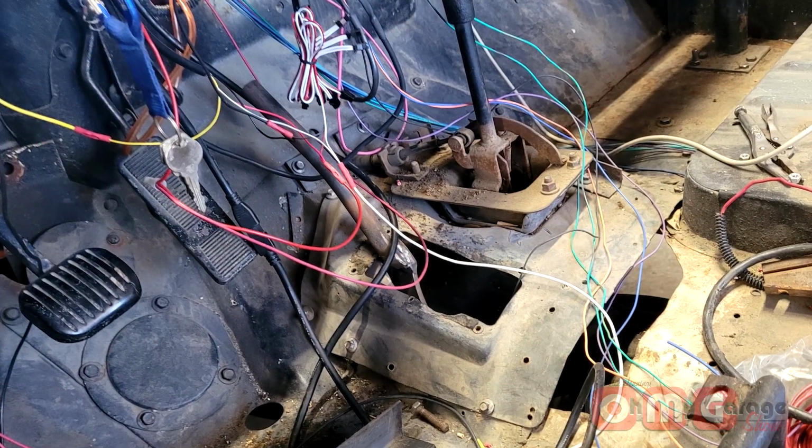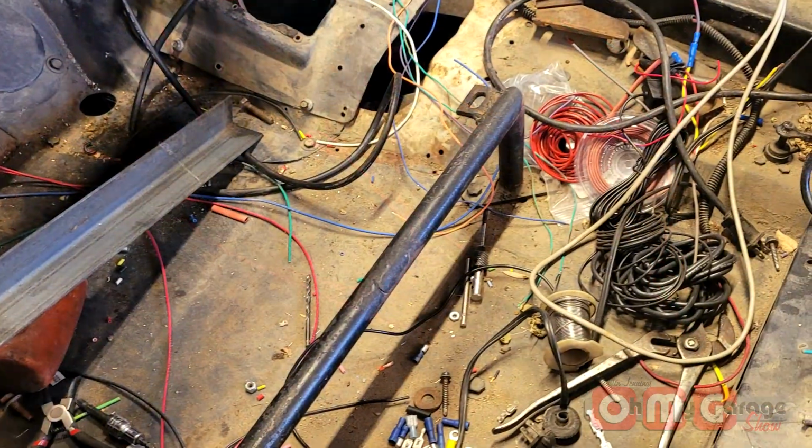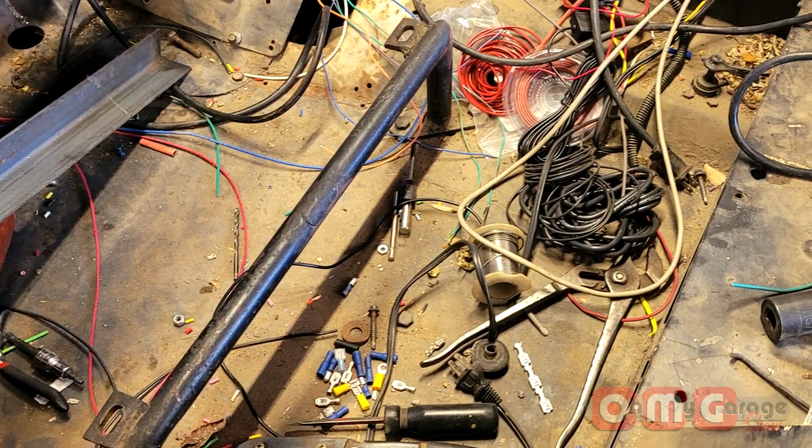Basically, the entire electrical was done. I bought a kit to rewire the whole electrical. I think I just bought a generic one, it might have been a Summit brand wiring kit. I mean, it's just wires. They don't have to be brand name. But the only lights in it that really were correct and working, and they were even installed goofy, were the headlights. And I had to redo those. So yeah, the turn signal, all the signal lights, all the wiring had to be done.